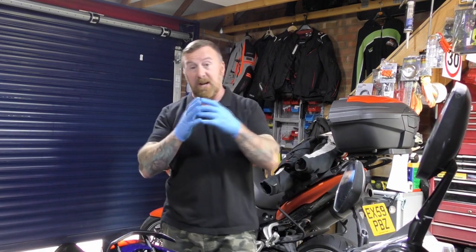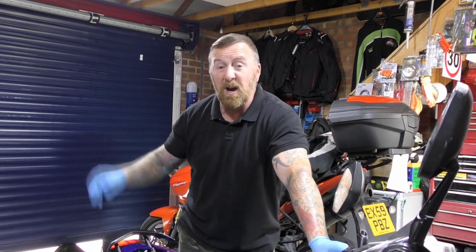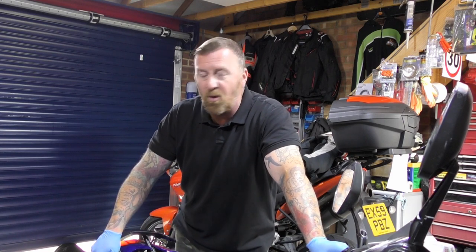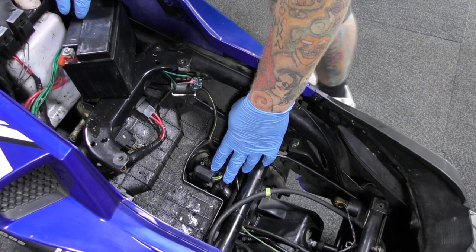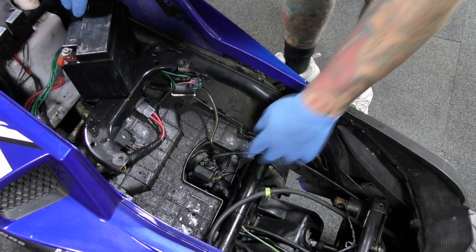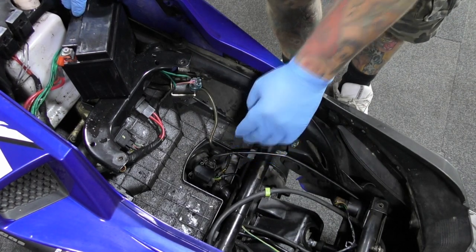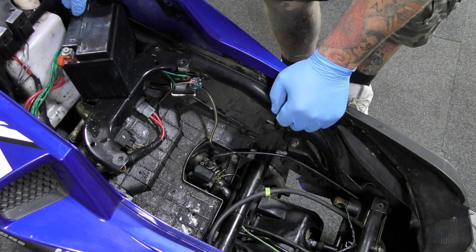There's going to be a lot more breakdowns. The 2T does not mix with ethanol — it just doesn't. Even that little 40cc over here won't run on it either; that will break down too, being a cheap simple carburetor. Here's the carburetor — this is the 2T oil going in there, accelerator, choke, and here's the inlet manifold. I've already took it out, cleaned it up, put it back, and drained all the E10 petrol and put super in, but now it's leaking like a sieve.